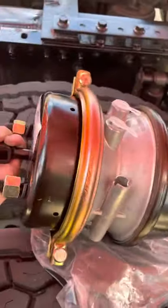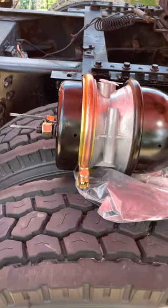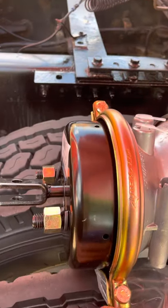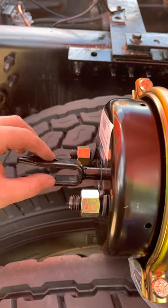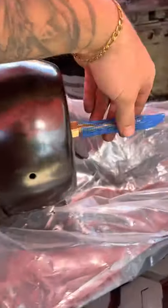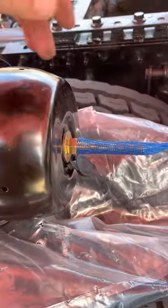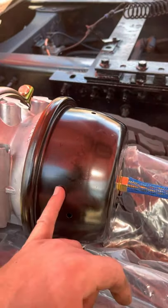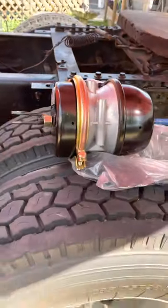The reason why you want to get these welded clevises is it's a lot easier to replace them — there is no cutting. The majority of 30/30s and different style brake chambers come with threads. This one is caged; they cage them for shipping purposes and installation to make sure the spring doesn't shoot you if you try to take it apart in front of the truck.